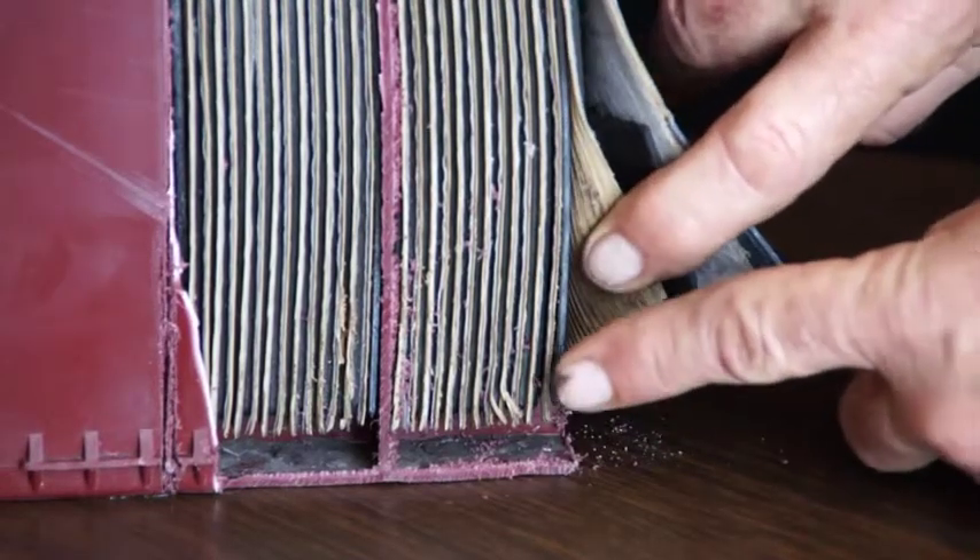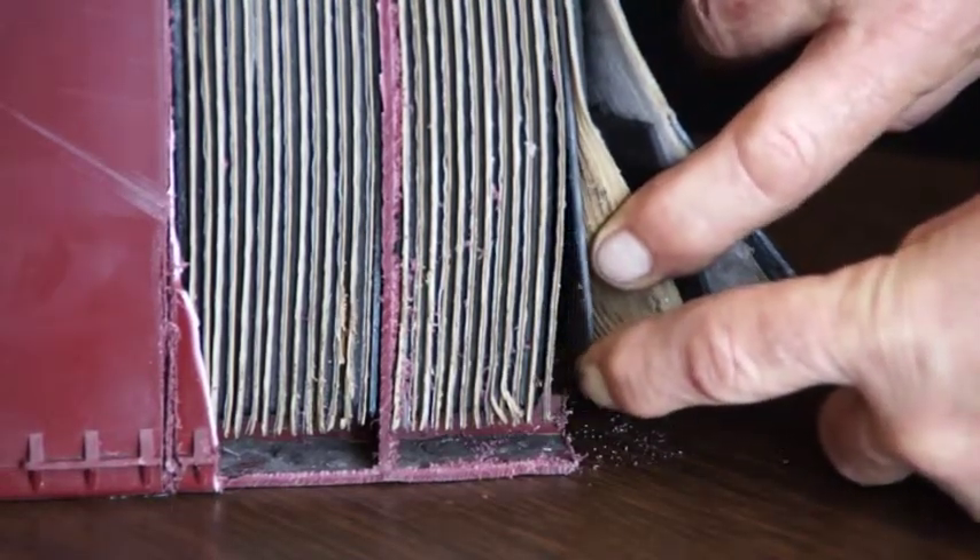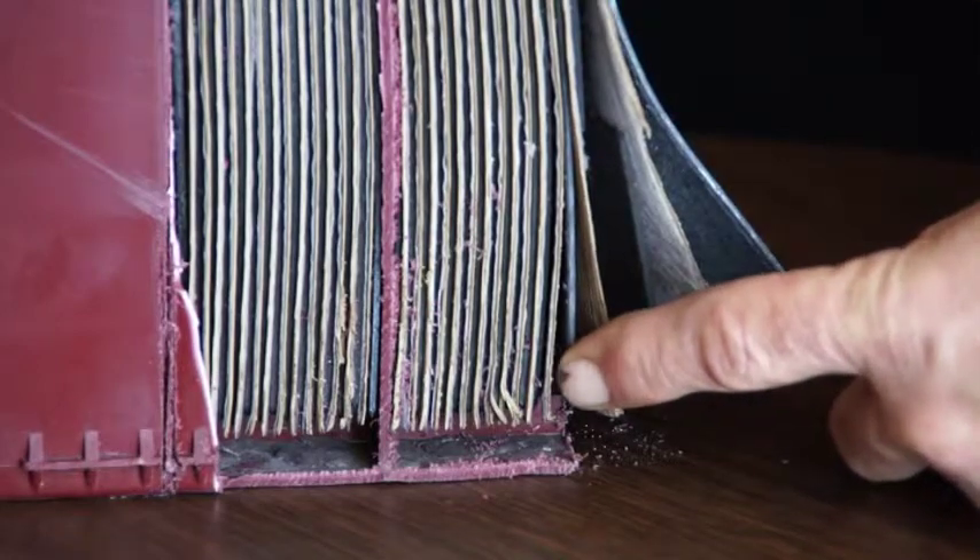What makes the quality? The grid material, the lead alloy, the lead that goes into it, the strength of the grid, and its resistance — so that we could get a battery that we only get two or three useful seasons from, or we could get a battery that's guaranteed for seven or ten years, which you pay, obviously, a premium price up front.